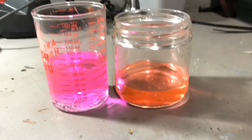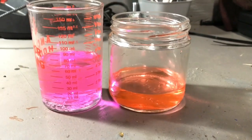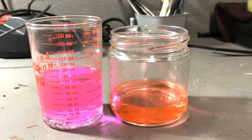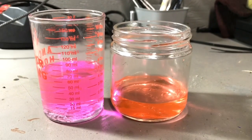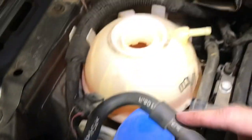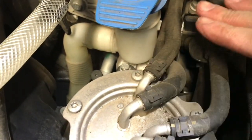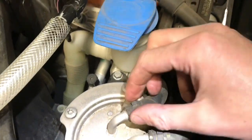I can definitely tell a difference — the new coolant on the left is a bright pink, and the old coolant that's been in there for at least five years and around 40,000 miles minimum has gotten more of an orange color. That won't necessarily be that obvious during the flush due to mixing, but at least I know what to look for. This hose is held onto the coolant tank by one hose clamp — the German hose clamps are different, with horizontal ears rather than angled, making them really hard to squeeze together.